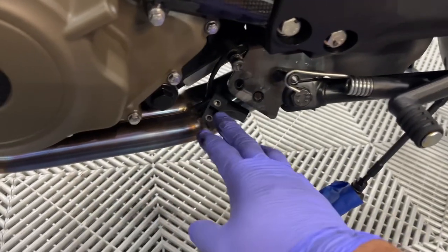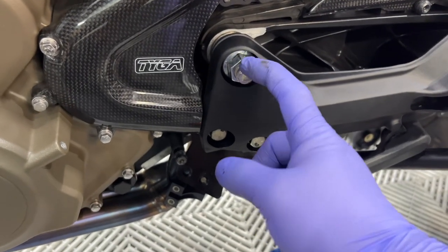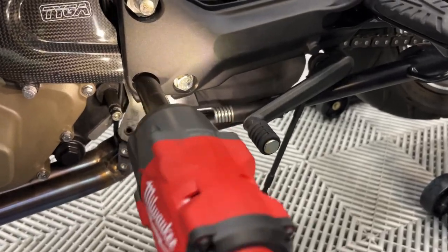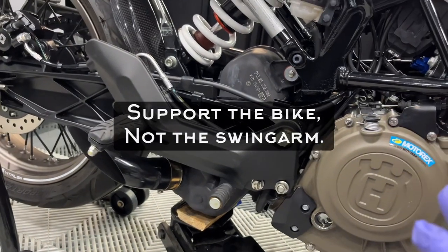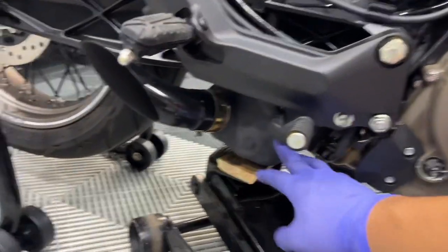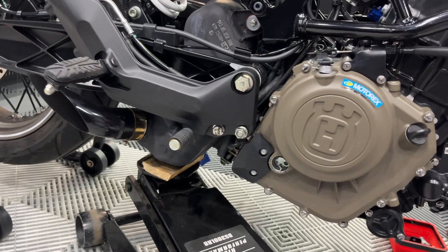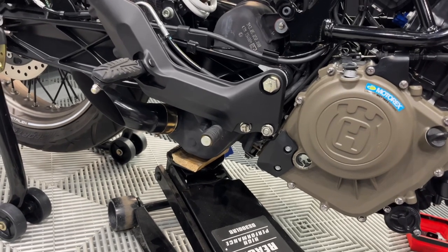Side stand safety switch is off. Be careful — I see why you'd use red Loctite here since this is safety-critical, but it's tough because the side stand switch housing is plastic so you can't heat the fasteners to loosen the Loctite. Now: swing arm axle nut needs to be loosened — that's a 19mm — and we need to loosen these two fasteners here, which are 14mm. We also need to support the swing arm with a jack. Taiga's instructions depict a bottle jack under the resonator box.